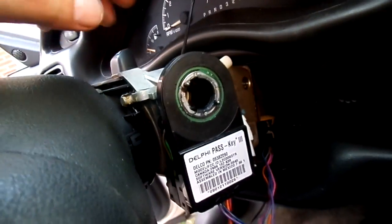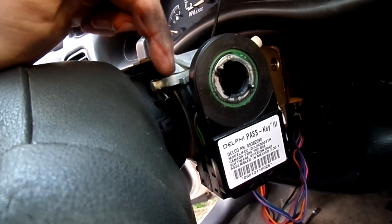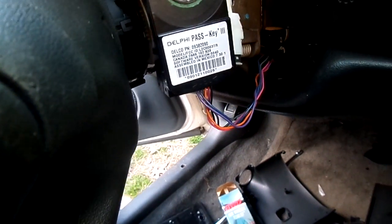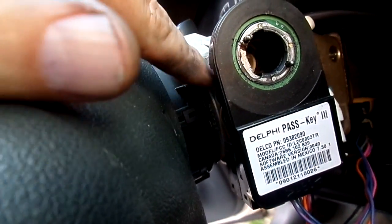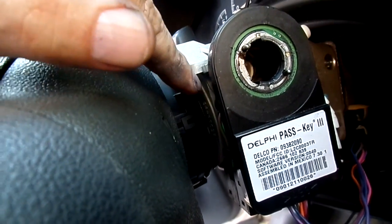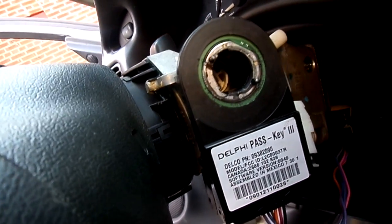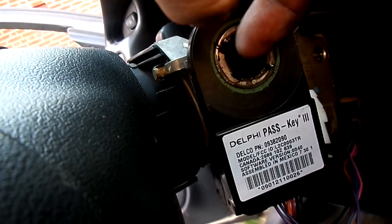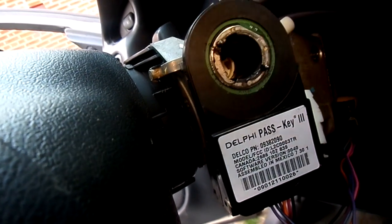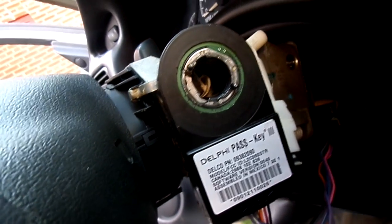And if you look at your ignition switch, right here, right under there, you'll have to use an extension to get to it. Same size external six, and it'll just reach right up there to it and slide right off. If you want to, you can actually take off the rabbit ears. You can just put a little flat in there and it'll slide off, no big deal.